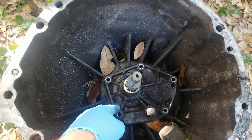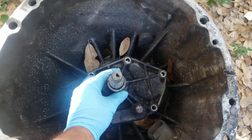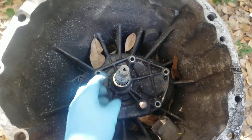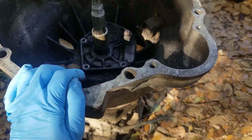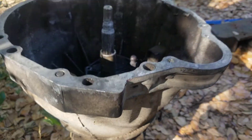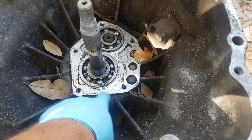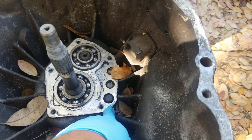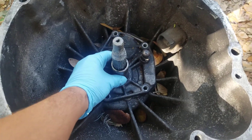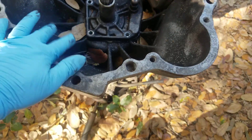This is going to be the rear adapter plate, which is actually no different than mating this one to the bell housing. What I'm going to do is cut the bell housing all the way through until what's left is even or flush with this back plate. Then the adapter plate — just imagine this is the adapter plate, except it's covering that entire area, that's now this empty space. It would be covering the entire area.